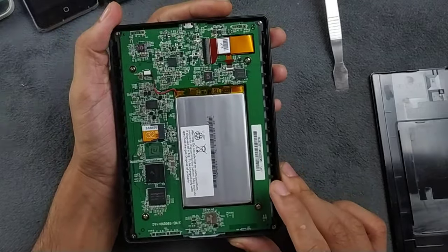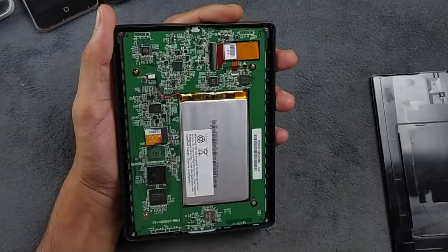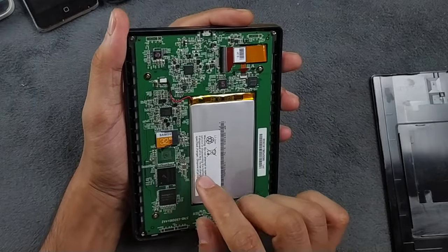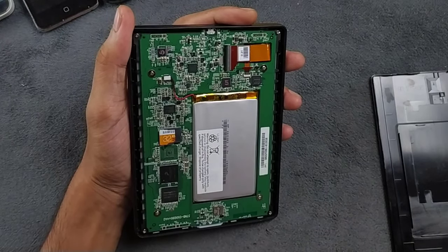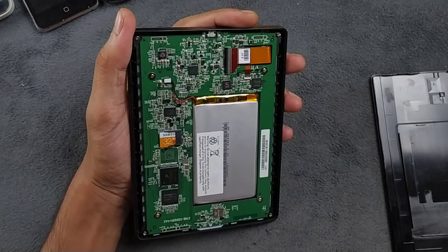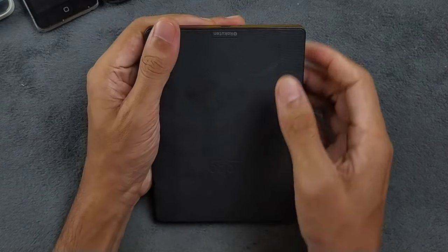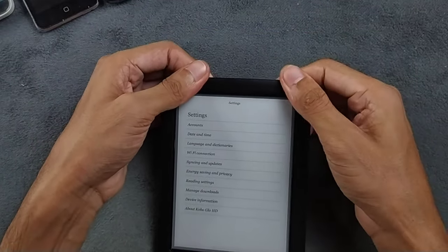As you can see, the SD card is inside the device. Swapping it isn't as simple as with a phone because the SD card also contains the firmware. You can't just copy files to another SD card — you have to make a full image of the original SD card, restore it to the new one, and do some partition adjustments to get it fully working.